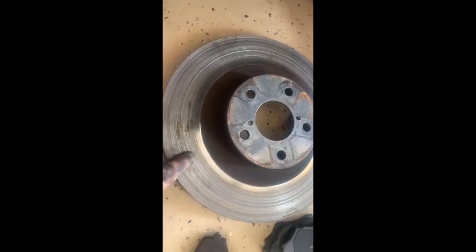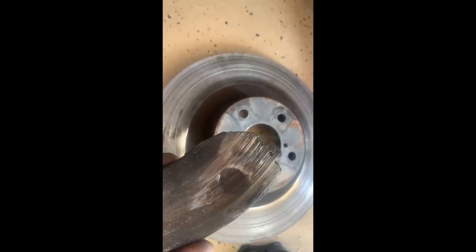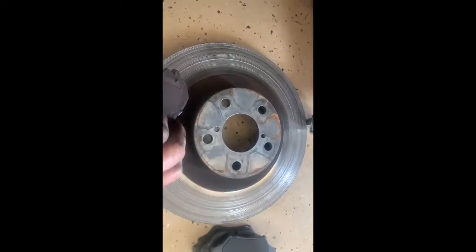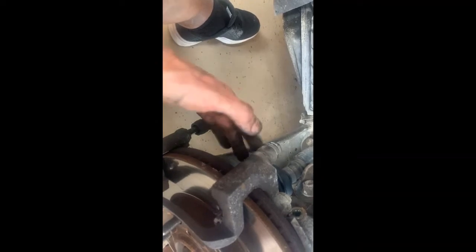Here's what can happen if you don't maintain your brakes — this rotor got completely chewed up, it's probably beyond resurfacing. You can see the brake pad was basically metal-to-metal. This happened on my son's car: a caliper pin stuck on him, all the other brake pads were fine but just that one corner wore metal-to-metal. He was hearing squeaky noises. So grease these caliper pins up and stick them back in.